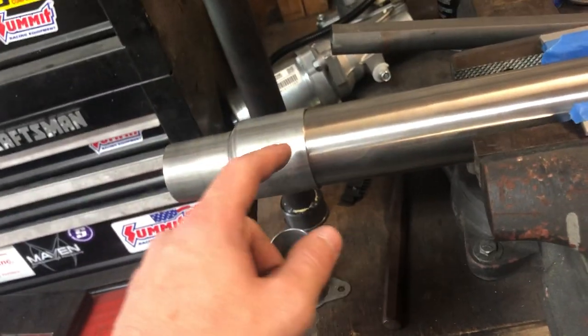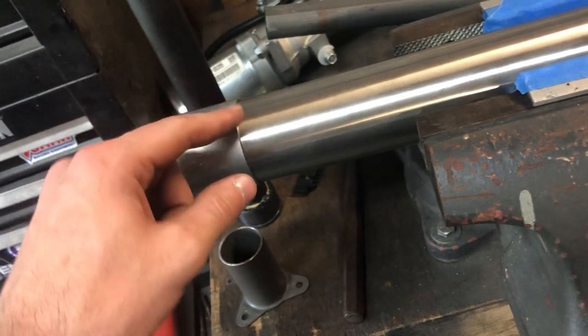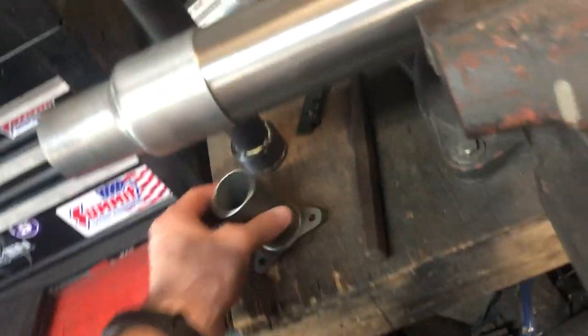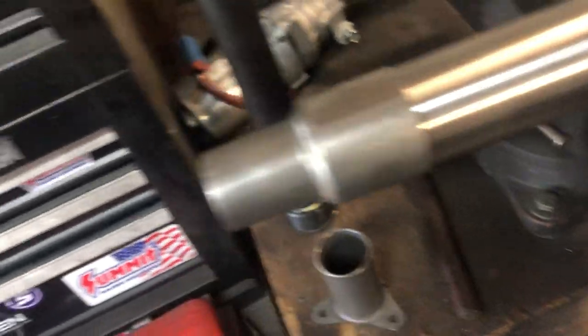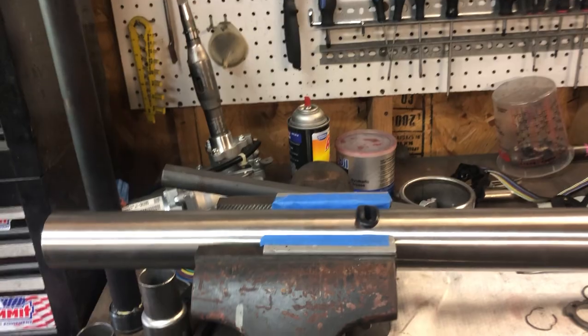In the video that Paul's build did, he drilled a hole through the column and plug welded. I'll probably run a bead all the way around or put triangulated beads - bead, bead, and then a bead on the underside, just a little half-inch. I might do a full weld on this one since it doesn't have as much sleeve material to stabilize it. I'll cut that and probably use this deburr tool - a carbide burr - to ream around the inside, shaving material off until this slips in. But I need to figure out my measurements first. Measure twice, cut once - and as they say, then realize you should have measured three times.